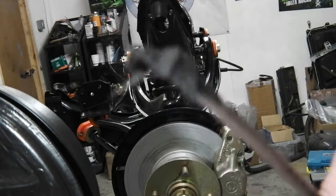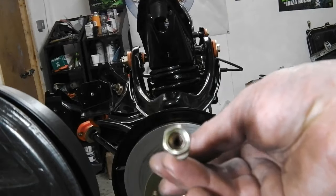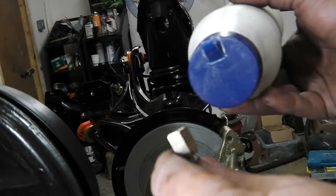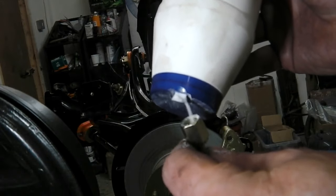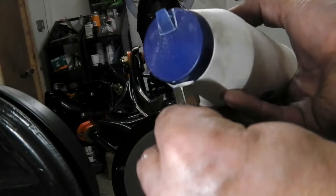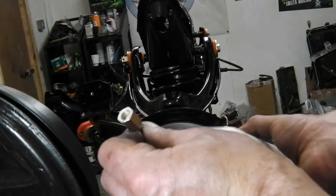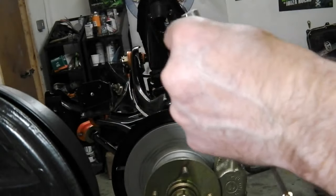I'll show you in a minute where we go, but just for the salt operation, I've taped up that end. Salt comes in this end, so grab the salt. This is so we can get tight bends without distorting the pipe. You'll see the salt going in. Lovely. Tap. You feel the pipe heavy up and the salt disappears down the tube. So there we go, that's ready for bending now.